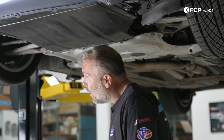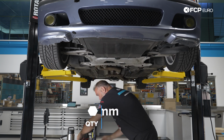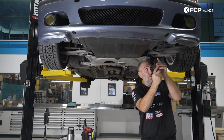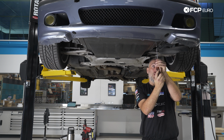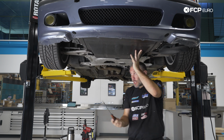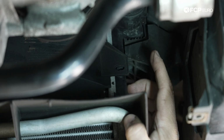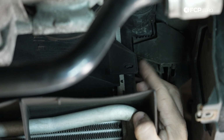So we're going to start here. 3 8mm screws in the back, and then we have 4 Phillips heads in the front. And then these Phillips head screws are 1/4 turn, and they're encapsulated in the splash shield, so you don't have to worry about taking them all the way out. So like I said, normally there's 2 T25 screws holding the fan shroud to the radiator.